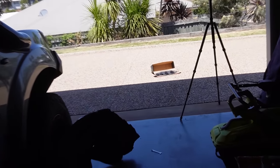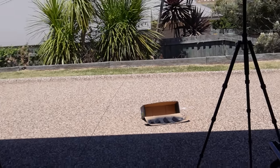I have finished all the drilling needed on the brackets, gave them a splash of black paint. So now I've just been crawling around, figuring out where I'm going to run the wires for everything. On this side, there's a loom that runs across the side of the chassis, so I'm going to follow everything on this side. And on the passenger side, it actually runs across the top of the chassis, so I'll do that for the other side. You can literally follow that loom up and in, and on the other side, where I've done the diff breather line from the rear, I can just follow that pretty much all the way up into the bay as well. So that's going to be the most tedious part, just feeding all the wires through.